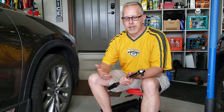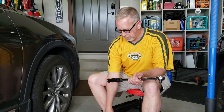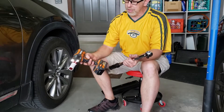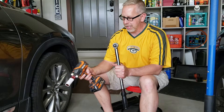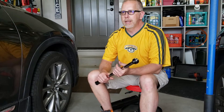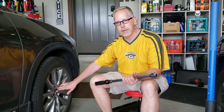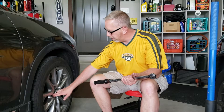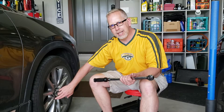What does this mean? Well, it could create some problems down the road. And this shop knows that I've specified that I want hand tools to be utilized and not an impact wrench. Most shops probably use pneumatic or air tools. They're torquing one lug nut to whatever that wrench will go to, and then coming over to the next one, expecting that wheel to somehow give in order to get it tight.